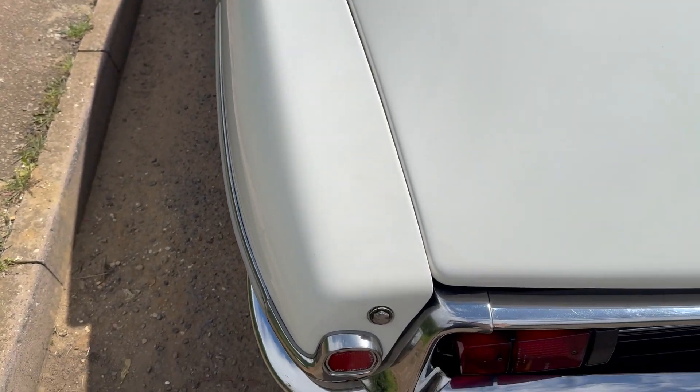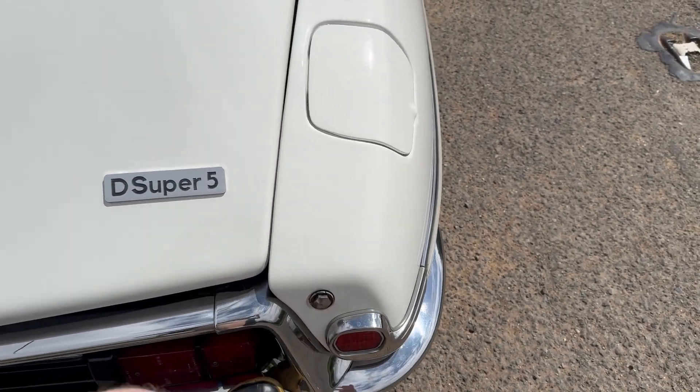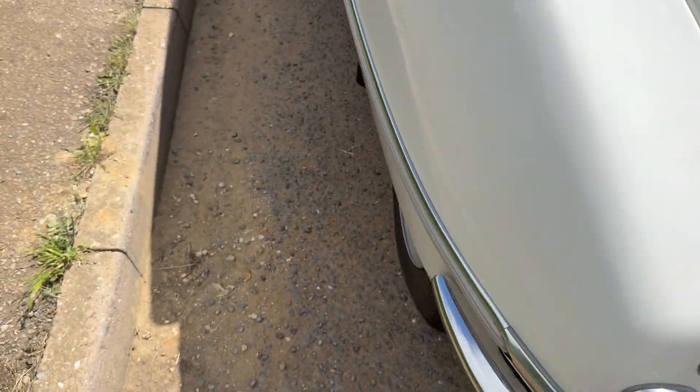In my tinkering around this morning, I've obviously done something to the suspension because the ride quality is now not shocking but very hard. I think it's the rear end of the car that's stiff - much, much stiffer than it was yesterday when we went over to the Little Hallward DS rally. I've stopped to see if I can work out what the problem is with the suspension and it's the rear left. That side hardly moves - that side's much softer. Yeah, that's kind of locked.